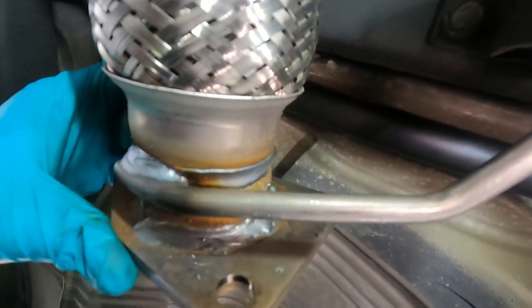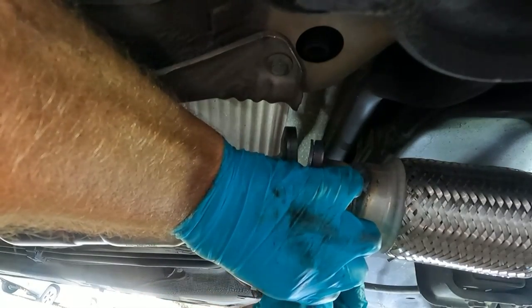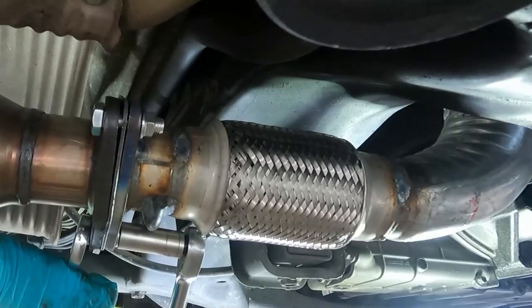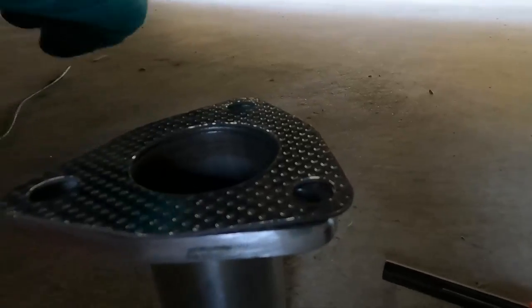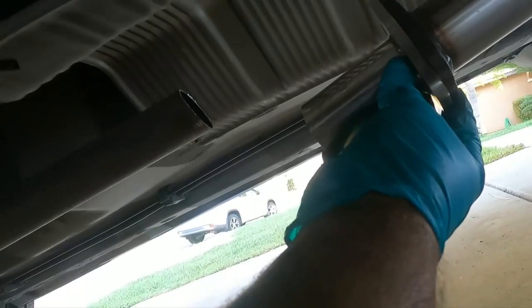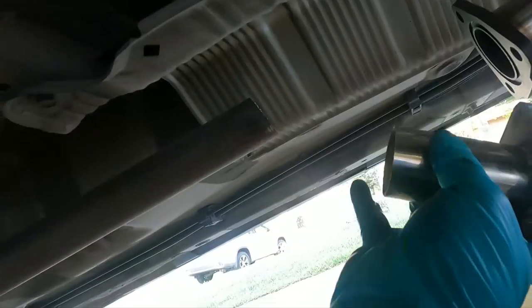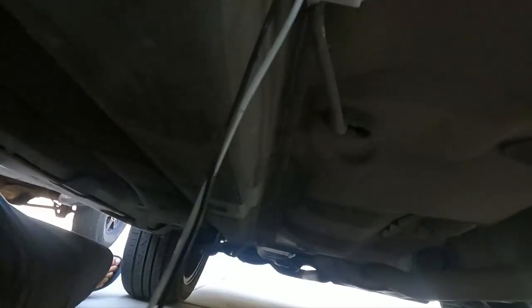The pipe is now in place and we've still got some wiggle room to line up the new catalytic converter. The catalytic converter is all bolted up on this front pipe and we still need to do our oxygen sensor. There's a little plug in here. This is the universal flange I bought — it's got a gasket and it lines up pretty well with the converter. But we're still going to be several inches short. I might sleeve and clamp it, or I might weld it. Right now I'm going to change out the oxygen sensor.